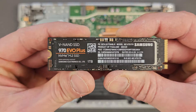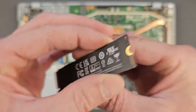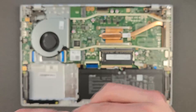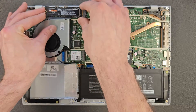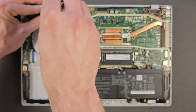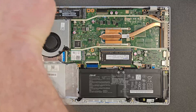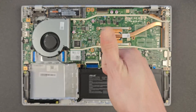Here's a closer look — one terabyte. One important thing: after upgrading your solid state drive you do have to install Windows again, and it was not straightforward on this machine. I do recommend doing a bit of research on that. I'm not going to go through it here but it wasn't straightforward for me, so hopefully you'll do a bit better. And that's it — upgrading done.